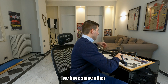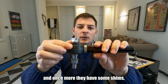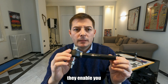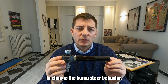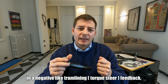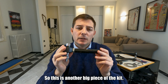We also have some other very interesting parts — new steering rods. Once more, they have some shims, one here and one here, and you can decide the position. These steering rods, apart from being reinforced, enable you to change the shims to change the bump steer behavior. Therefore, the car can be much more neutral and you will get less negative feedback to the wheel — like tramlining feedback — whilst the car is both squatting and rolling in and out of curves. So this is another big piece of the kit. This is all motorsport grade parts.